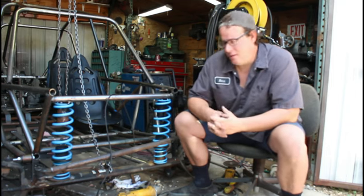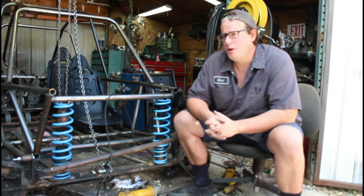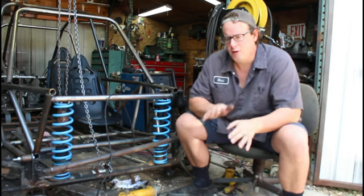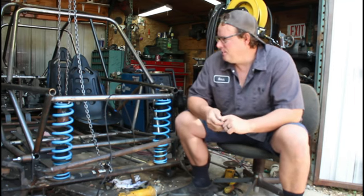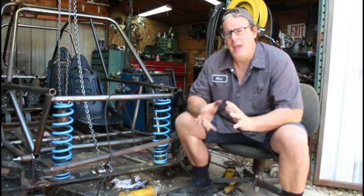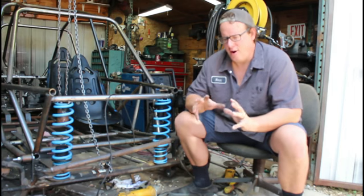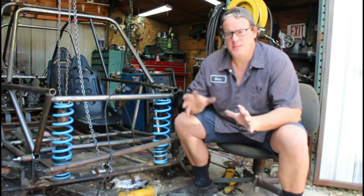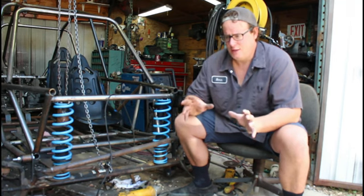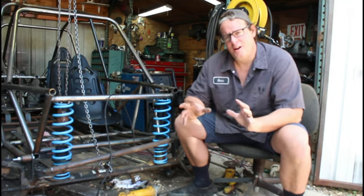And there's aftermarket support. Now, admittedly, getting hard to find the parts, but you can build that transmission however you want. With super low gears, super high gears, super close together. You can even build it where you have a good low starting gear, high speed gear. And that is generally what most people do when they say, hey, I'm going to build a buggy, right? Just from the ground up, they're going to say, I'm going to start with some sort of V-dub bus transaxle. Which, that sounds super freaking stupid to do what everybody else already is doing.